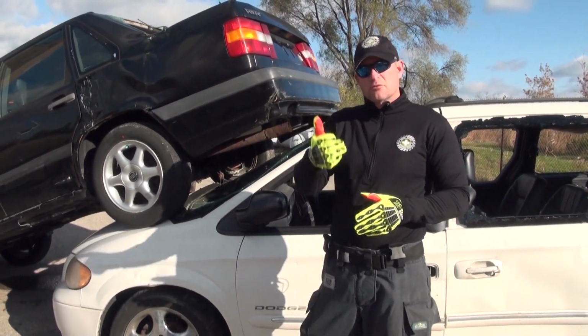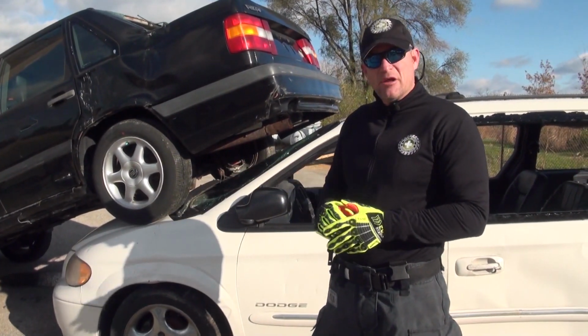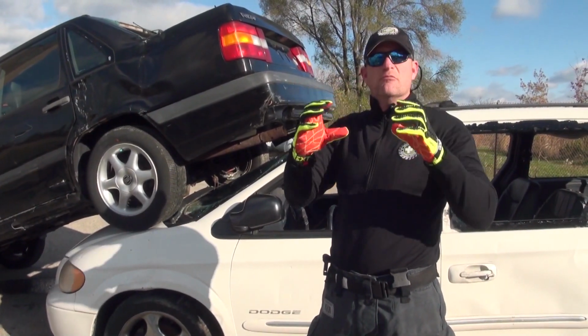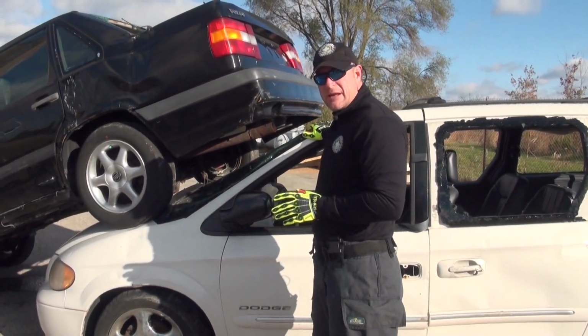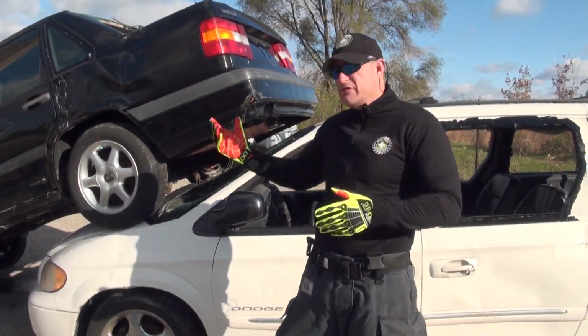So remember your rules. Rule number one, start with the vehicle that goes to ground. Get it stabilized and secured to ground. Then compress that vehicle so it's not going to move or travel, and then jump to the independent load and secure it to your primary stabilized load. Make one tight package. That's option one. We'll do that now and then we'll talk.